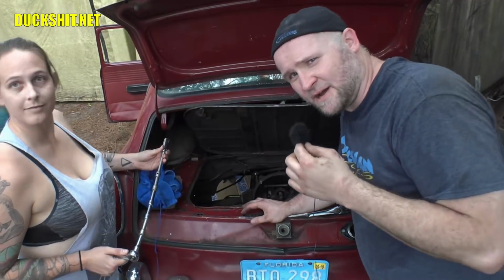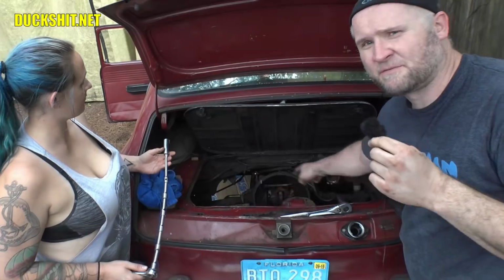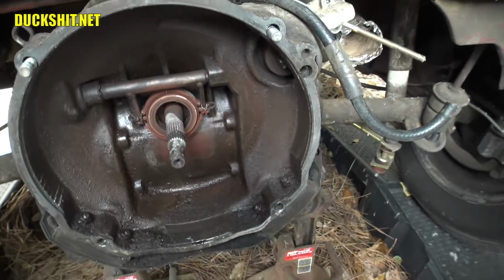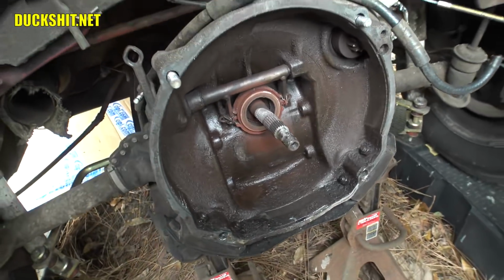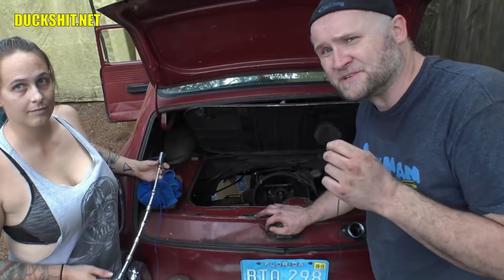Okay, well, we're back. You saw how the engine came on out of there in some of the previous videos that I've done before. But what we've got down below is a greasy bell housing down in here. And it's quite a mess. I think the main seal on this engine is leaking, so we're going to actually pull it apart and just replace the seal because it's easy to do while the engine is out.